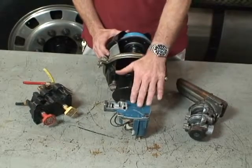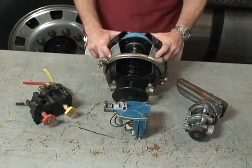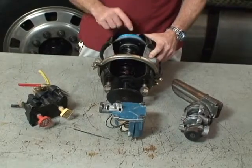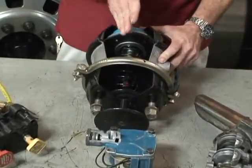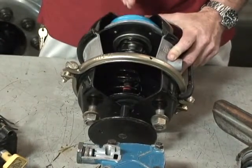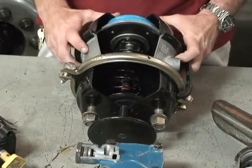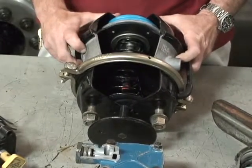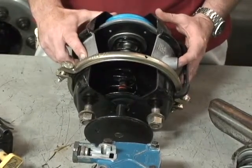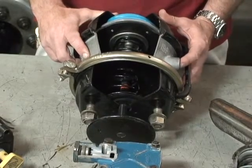The anti-compounding relay valve system. When we have the parking brake applied, this part of the brake chamber is pushing on the slack adjuster. It has about 60 pounds per square inch of force being applied to the wheel ends, to the slack adjuster. That's fine — we can go up to 150 psi working pressure on our foundation brakes.